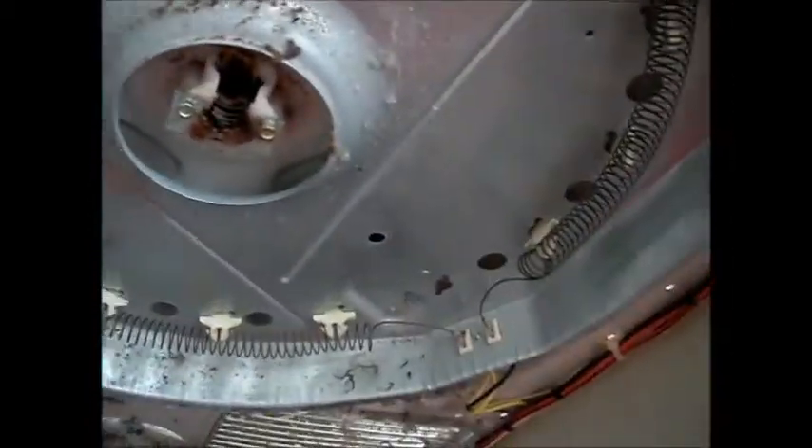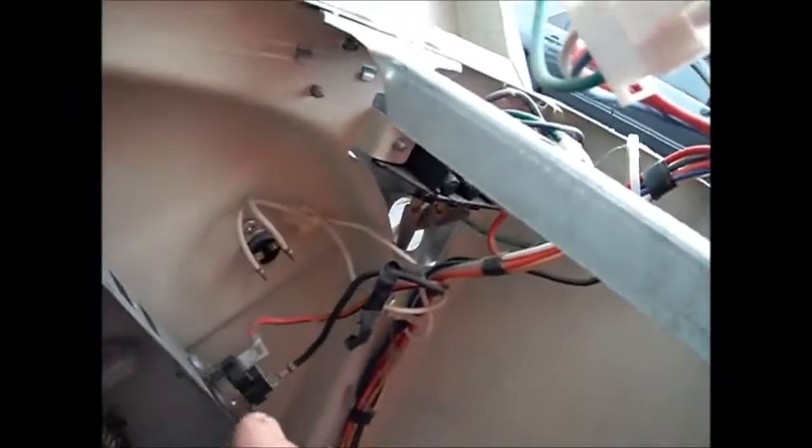Okay, there's the front panel off. There's the bushing bearing — that cup that usually gets dry. There's a close look at that thermal cutoff — that's the one that usually goes bad. Always check here for burnt wires. We can see the heat element is intact, so it's actually not the heat element causing the problem. This overload fuse usually blows when you're doing back-to-back loads or you have poor flow on your vent system.